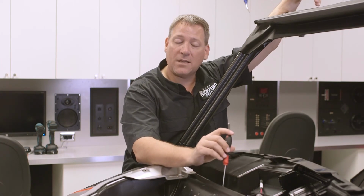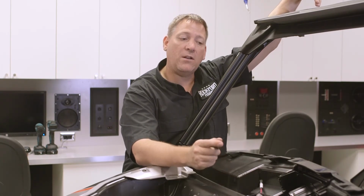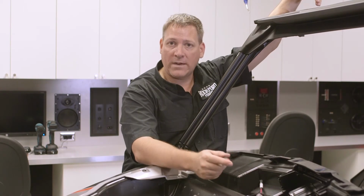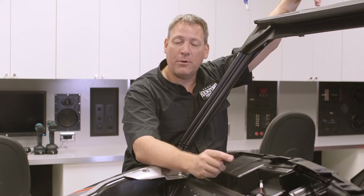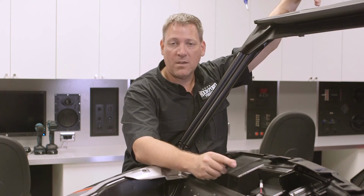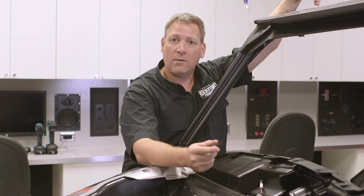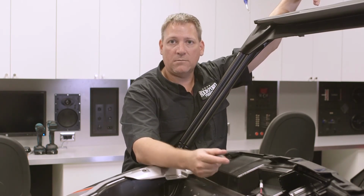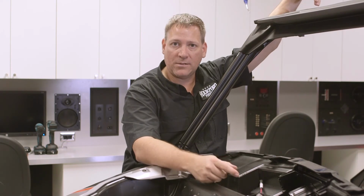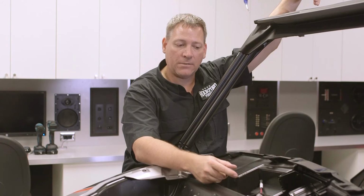Next, we're ready to set up the gain controls, or the output level controls of the amplifier. First thing you want to do is find out at what level does the radio clip. This is indicated on the amplifier by the input clip indicator light. To do this, you can either utilize the test tones that we provide with the amplifier, or you can also use music, typically stream from a Bluetooth device. In this instance, we're going to utilize music for our application.